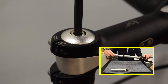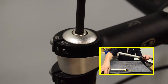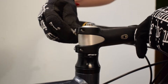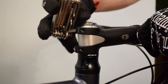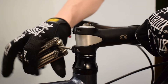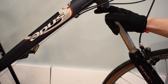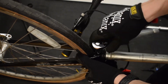Hey guys, a couple of months ago I made a video about an adapter to extend the steerer tube by 15mm. However, it's missing the functionality of a headset cap for adjusting the preload on the headset bearings. What it exactly means is that you could have back and forth play if the headset is too loose, or your handlebar would not turn freely if it's too tight. So tightening your headset bearings to the correct amount of preload is very important.